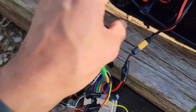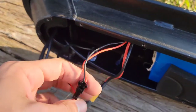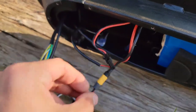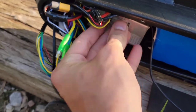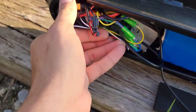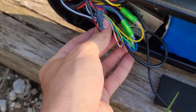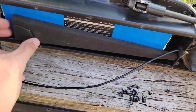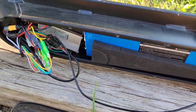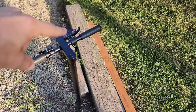That's pretty much it. Here's your charge port right there — you don't have to do anything with that. Then you just feed everything in and get it to fit — that's the fun part — but it's actually not too bad on this scooter since there's a decent amount of room. Make sure all your wires fit, put the foam piece back in, put your bottom back on, and you're good to go. That's how you swap from the original controller to the SL-100. Thanks for watching!